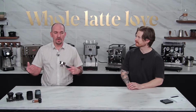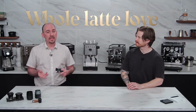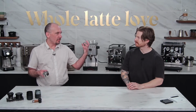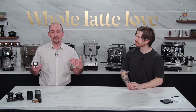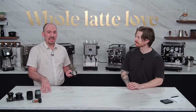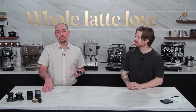So on something like the Solus, especially if you want to avoid a situation like that, because the boiler is still going to be hot when the machine is on, but it's not going to be as hot as it can be, you may eventually lose some of the water that's in there. So my recommendation, especially because the group isn't being actively heated, would be to run some hot water on first heat up through your portafilter so that you can guarantee that you're going to get the maximum amount of water out for your pre-infusion, as well as having the portafilter preheated.